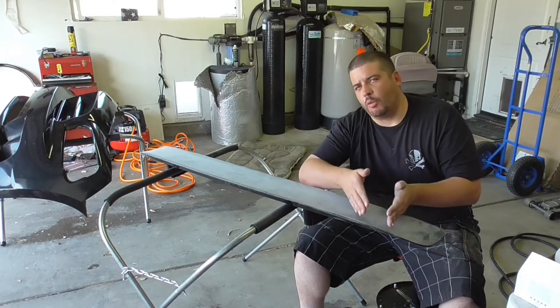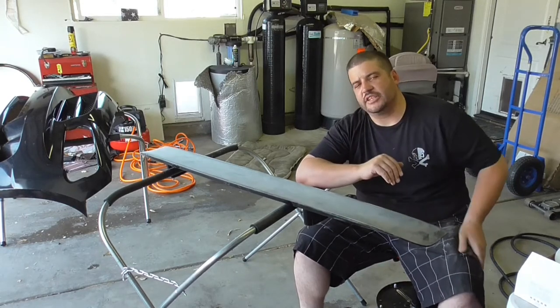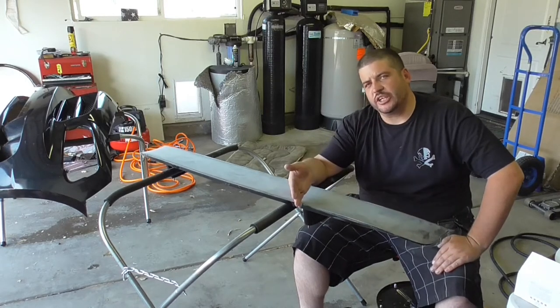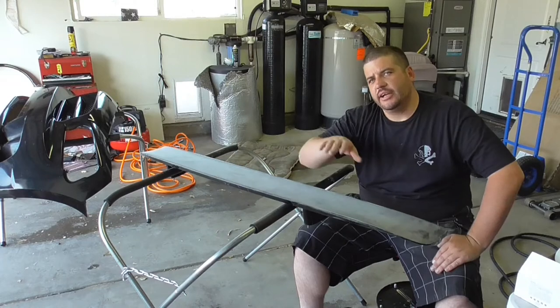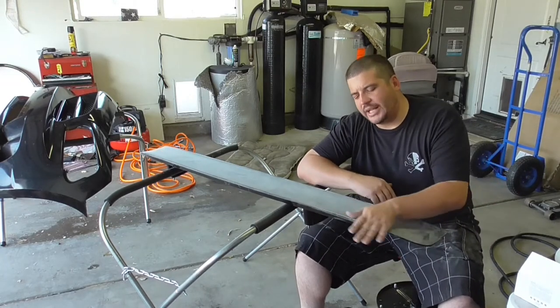You don't want to go from a 120 to a 320, or else you're going to be hitting a rough surface. You want to keep going up. So I'm going to go back to a 180, then to a 320, and then a 400 after it's all done. The 400 is going to be either a dry or a wet sand, though.